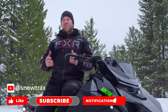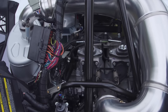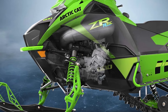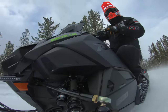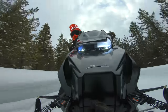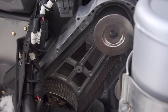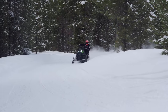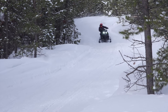Let's talk about something that hasn't changed a whole lot — the 600 CTEK 2 motor. It's still the same CTEK 2, but to get it to fit into this snowmobile, they had to make new motor mounts. It shifts the engine down an inch and back an inch compared to the previous chassis. When they hooked that engine up to the belt drive under the hood — which is an industry first on the trail — it really made that CTEK 2 600 come alive. The engine sounds great in this sled.